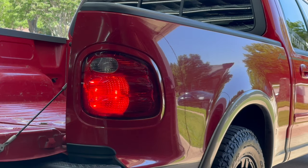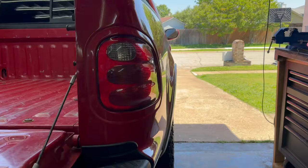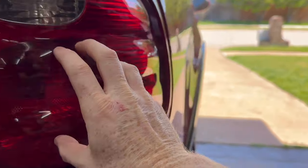Today I'm going to show you how to separate the turn signal and the brake light from taillights that have the same brake light and turn signal bulb. If you've modded enough lights, you're going to come across this issue — the brake light and turn signal being from the exact same bulb, and the wiring being the exact same wire. It's going to have three wires going to that bulb: ground, park, and brake/turn. And that's the problem.